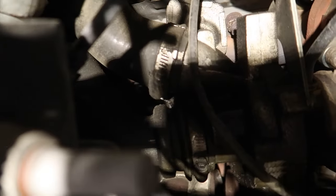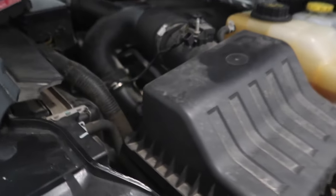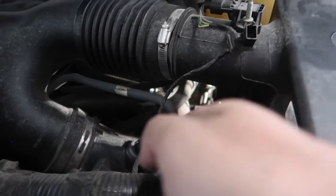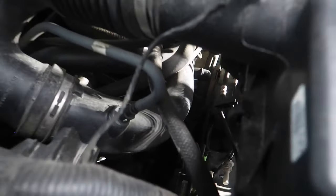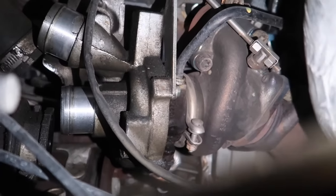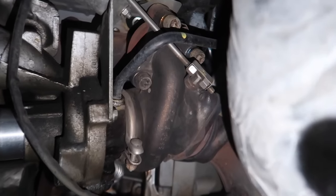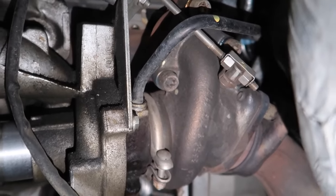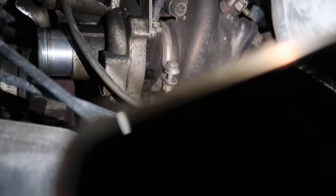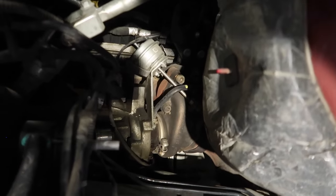I pretty much loosened up the two hoses to the back of the turbo. These two hoses connect to the charge pipe and the intakes. I'll remove those so I can pull the two hoses back and disconnect them from the turbo. That black hose right there has a retaining clip — I just removed it, got those two lines out, and got the vacuum line out as well. Let's pull that hose up — you have to wiggle it back and forth so you don't break it. There's one on the back of the turbo too. Let me get a bucket down there and start draining the coolant.